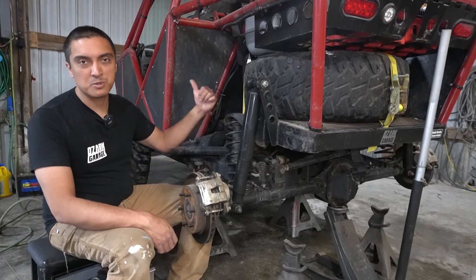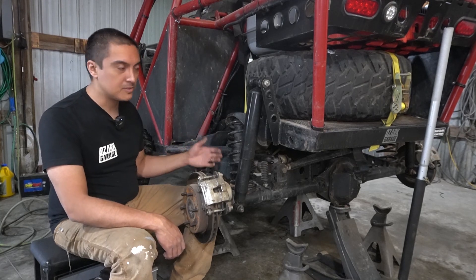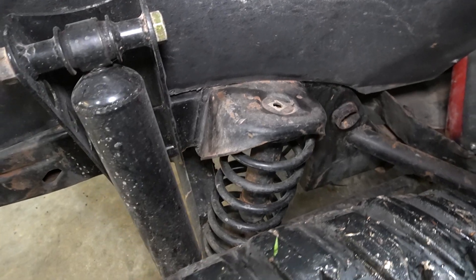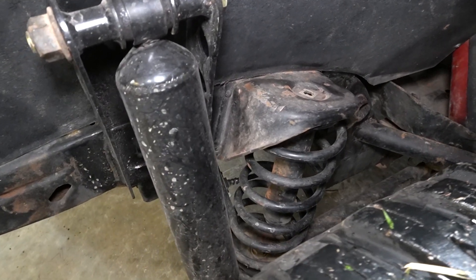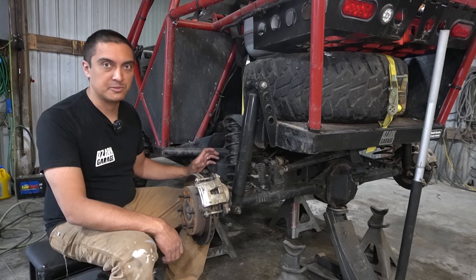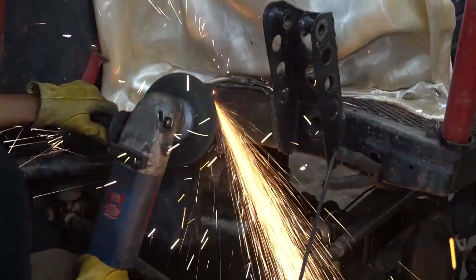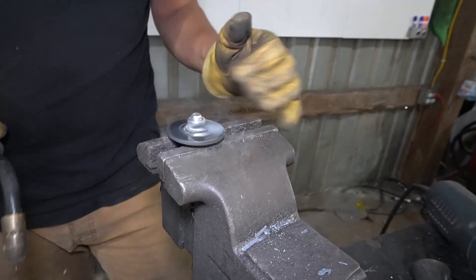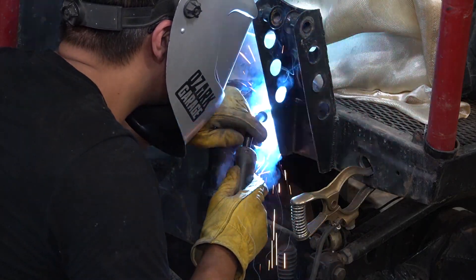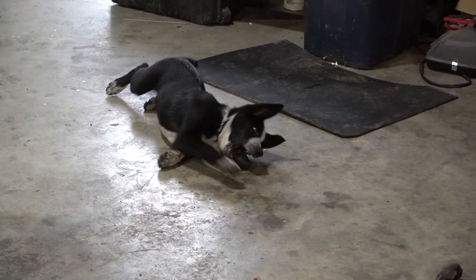We got the Perry Parts bump stop swapped into the front and now we're switching over to the rear. The front coil mounts I made and made them adjustable, so they were comparatively simple. The rear coil mounts are from the actual 1999 Chevy Tracker — still factory in the factory locations. So I'm going to have to cut these off and weld them an inch lower to get the inch we need. The plasma cutter made really quick work of removing the coil mounts from the frame, then I used a seven inch grinder to clean up and modify the bump stop mounts just like I did the front, and welded them back in an inch lower than they were before.